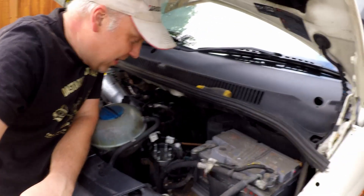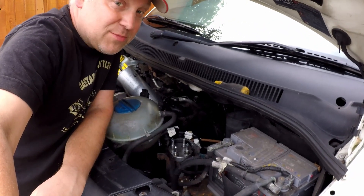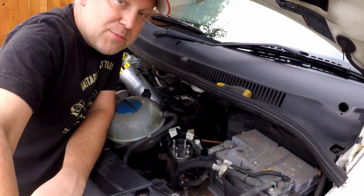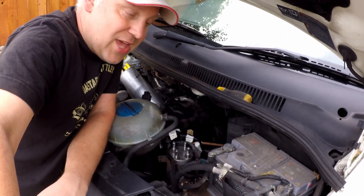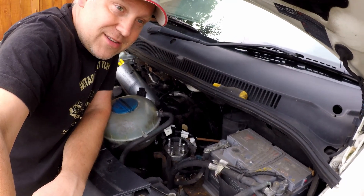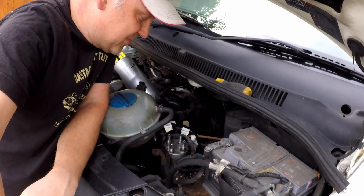That is one of my pet hates — people putting the fuel filter on wrong. I've actually had this before where a VAG specialist put the fuel filter on the wrong way around and basically gave unfiltered fuel direct to a common rail injection system, which then destroyed it completely. So let's see if we can get it the right way around. And this bracket doesn't look right considering the fuel filter's a set size — let's see if we can fix that.